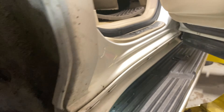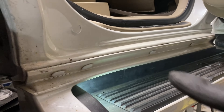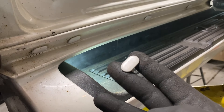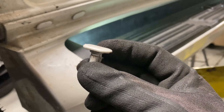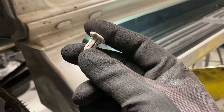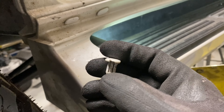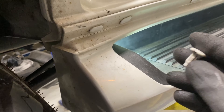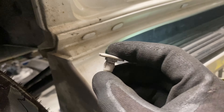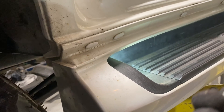The first thing we'll need to do is remove these clips located in the door jams — underneath the door jams on both front and rear. Most of them are probably going to break because I'm too impatient. To get them out, come in with a pick tool or small flathead screwdriver, push the two tabs in, and then pry out.